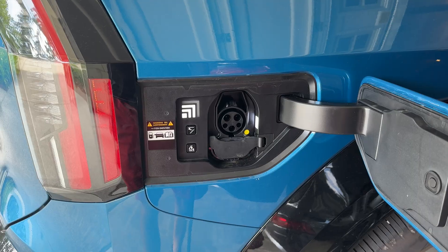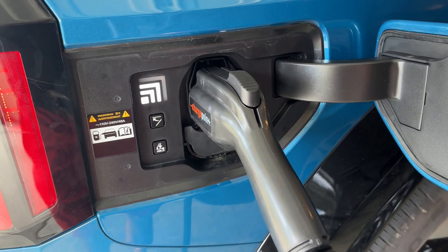Even when the car is plugged in and charging, can we somehow tap into that and charge a dedicated battery pack for the dash cam? So the wall could charge the battery pack while parked instead of draining it. It's a really cool idea, and if somebody knows how to do that, it would be awesome. But I'm worried — if you tapped into the wrong circuit, you could take out the whole battery. EV battery replacements run $50,000–$60,000 for some people. I asked a bunch of installers and nobody wanted to go near the high-voltage system. I asked Kia's engineers and techs directly and they said that's not what it's designed for. I haven't figured out a way to do it, and I don't think I've seen anybody who has.